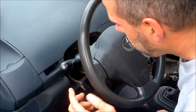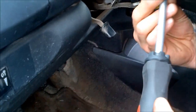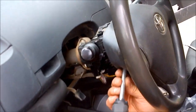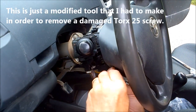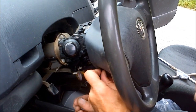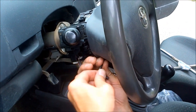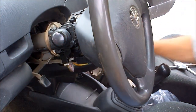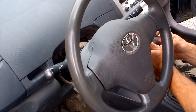The next part is pulling off the center horn section or airbag. There are two screws, both Torx T25, one on each side. You may need to look in there to find the holes before you try to get in. When you put it back on, torque it down to about the same feel as when you pulled it off — I can't remember the exact foot-pounds, but it's only the horn, not the critical steering wheel.